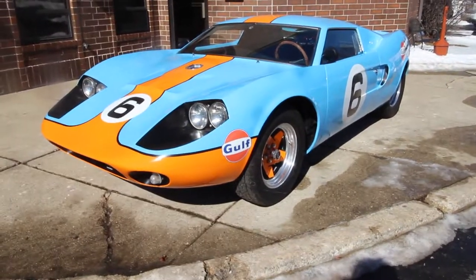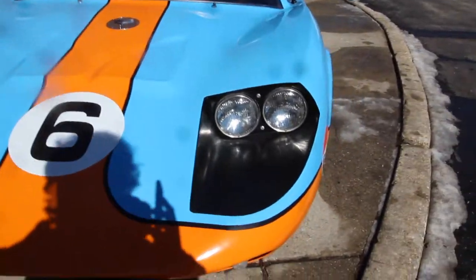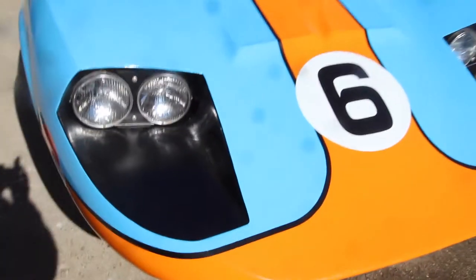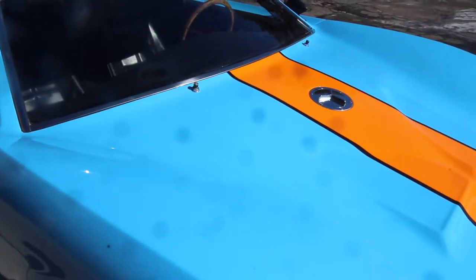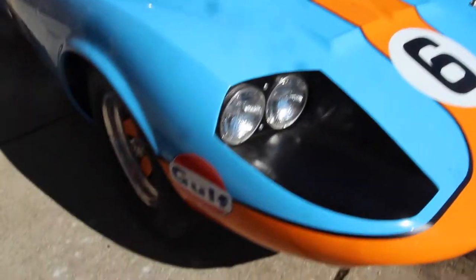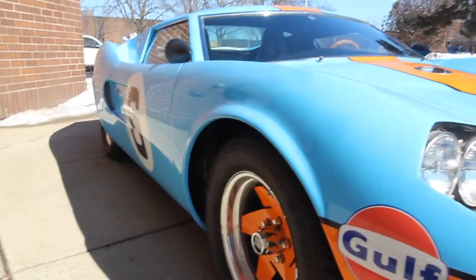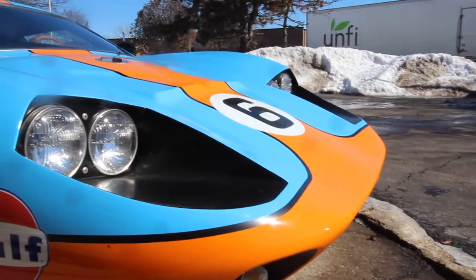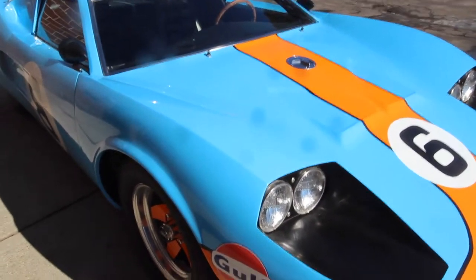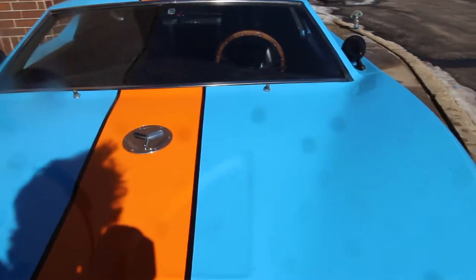It's wrapped in Gulfstream blue with those factory race colors. It's a modified '66 Volkswagen chassis, which is in excellent condition — no rust, no surface rust, beautiful underneath. It's got a different front suspension on it; it looks fancy, not like something you'd find on a Volkswagen. It has a Crown competition clutch, a 780 CFM Holley carb, and a '65 Corvair motor with a turbo intake that puts out 240 horsepower.